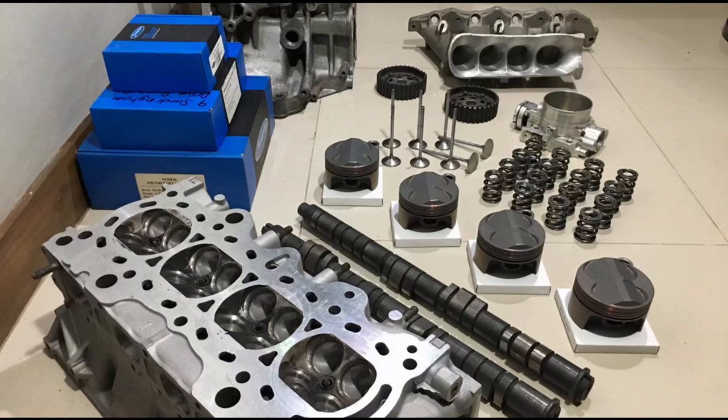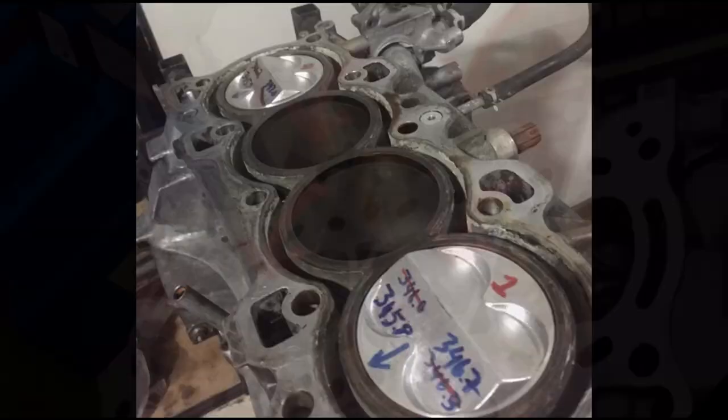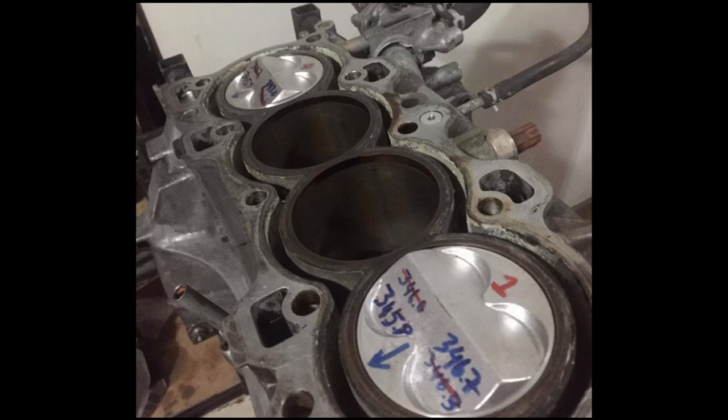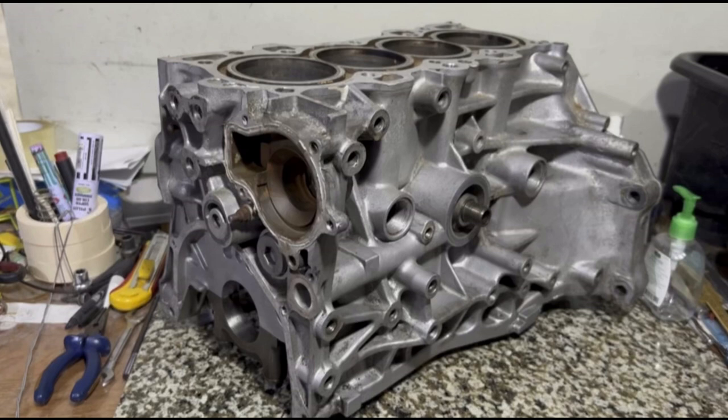Let's start with this picture. As you remember, here is the oil drain — up in the exhaust, then the intake, and also on the corners. When the head gets filled with oil, this is also filled with oil draining down to the block. That's also where crankcase pressure escapes — from the block up to the head. So when you put a breather on the valve cover, yes it helps, but when it's overfilled with oil draining down, it may not totally let the crankcase breathe well.